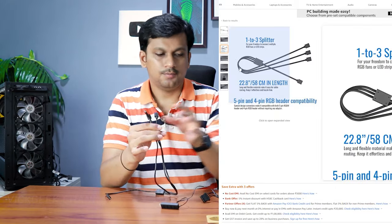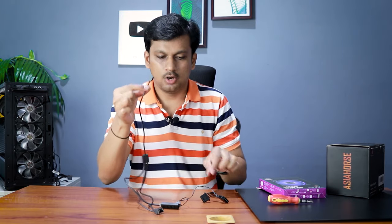What this wired controller does: there are three RGB connectors on it, so if I have three fans I can connect all three to this one. The other pins from the fans go to SYS FAN on the motherboard. On the other side, the RGB controller itself connects to the power supply cable coming from the PSU - there are a lot of slots available, just plug in there. The one downside is you cannot control the lighting using PC software; you can only control it using this physical controller.